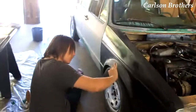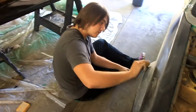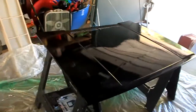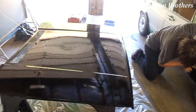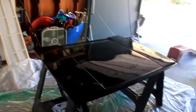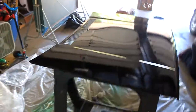Cars and Coffee is less than a week away, so I'm not thinking too optimistically about having it painted for it. We'll see how far we get. I just threw another coat of black on the hood and you can see the eggshell texture — it's not too bad. It will actually dry smooth. That's the beautiful thing about thinning it with mineral spirits: it takes long enough to dry that the paint has time to level itself out because it's on a flat surface. That's another successful coat of black on the hood. We'll probably do one more before we sand it, but you've got to wait about 12 hours between coats at least. That's a project for another day — today we've got to focus on getting these stupid things done.